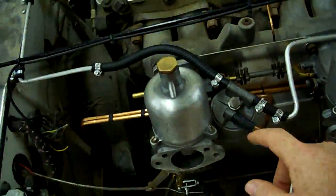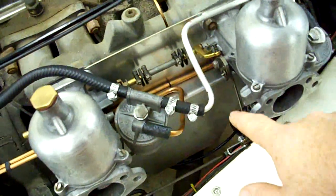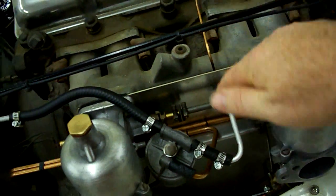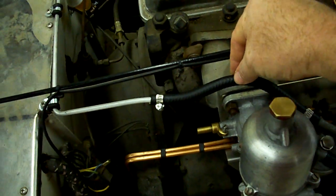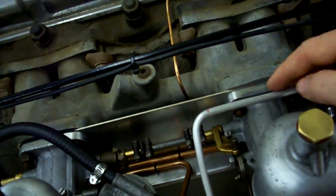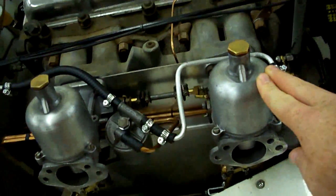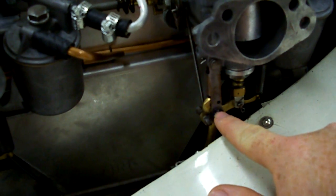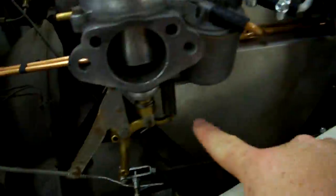After a lot of work, I turned them into good carburetors. I did a lot of plumbing work, added a heat shield — made a heat shield for it — and drain tubes. There's a lot of custom pieces in these carburetors. Down under here, there's a little fitting I had to make that was missing. All these little pivot points, I had to either bore oversize and make bushings, because they were just completely worn out.